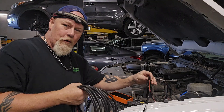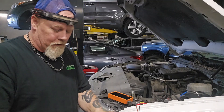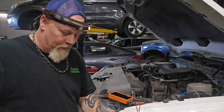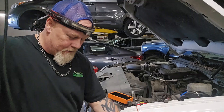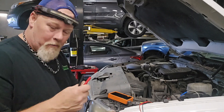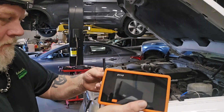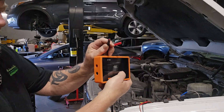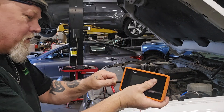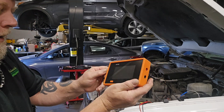It's important that the fuse goes to the battery side because that's where the power comes from. You want it to be fused straight out of the battery right away — you don't want it to travel through all these leads if there's a problem. We're going to take these two, plug into the Devo — there's a red and a black on this side — plug in the black and plug in the red.